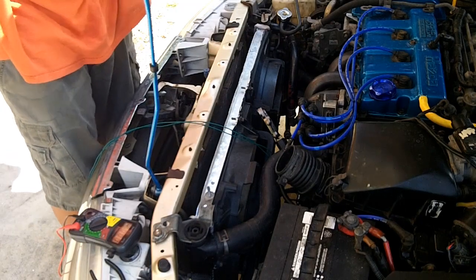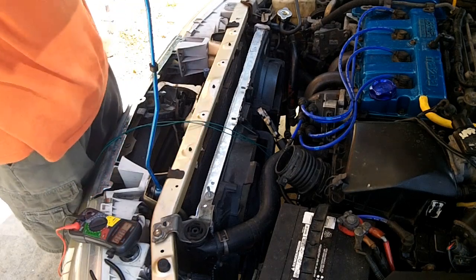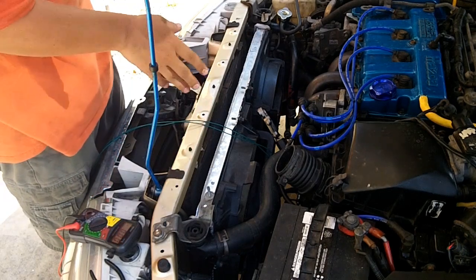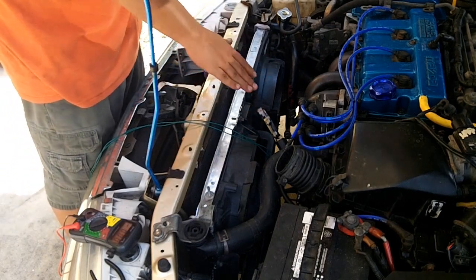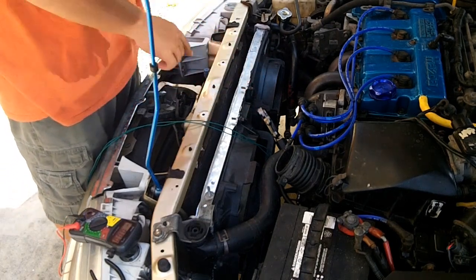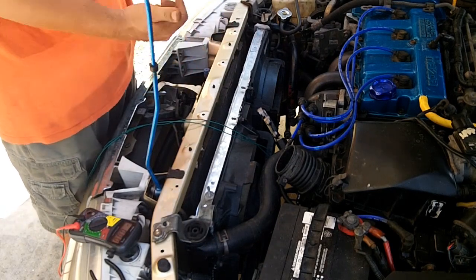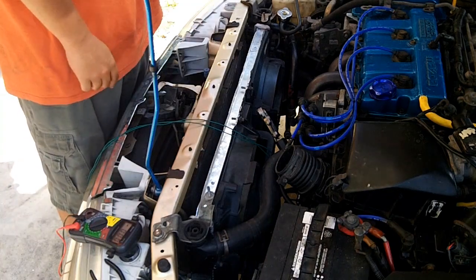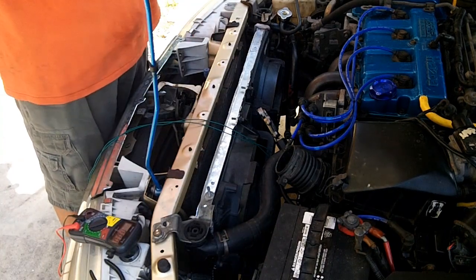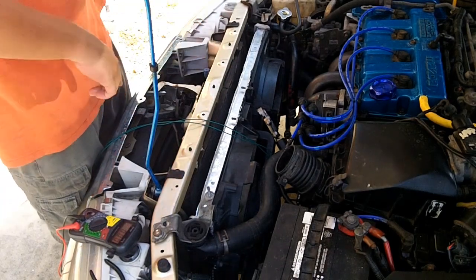That could be. Okay, so everything works on battery voltage. The reference signal is only for the test pins. The reference voltage is also so that the PCM will see that the transaxle range sensor is working. So it routes a signal through it, and if 5 volts go in and 5 volts go out, and it comes back and says, I see your 5 volts, that means the transaxle range sensor is working as far as the PCM is concerned, and then it will start switching and doing all the other stuff.